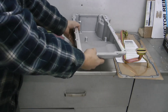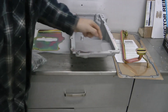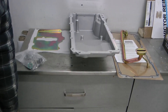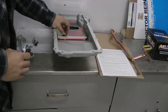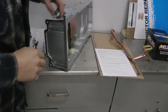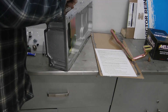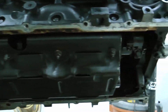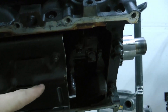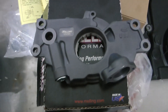This is a great pan and includes new bolts in the kit, which is amazing — you don't have to use your dirty old ones. It also comes with the pickup tube and all the gaskets. It actually has drain holes on the side for your turbo, which is awesome — though this car isn't getting a turbo yet. Take note: you'll need to cut the windage tray; I cut it in line with this bolt here. For an oil pump I'm using the Melling 10295 high pressure pump. Note that this style pickup tube requires the black O-ring.